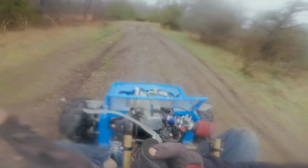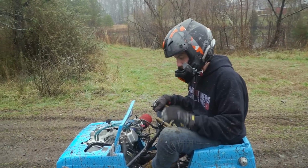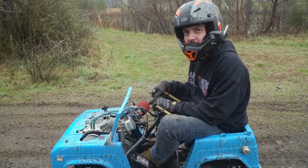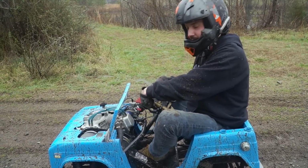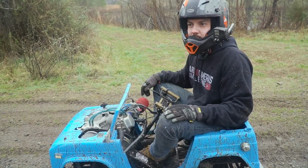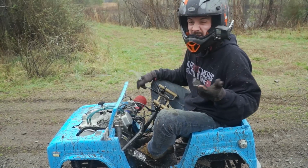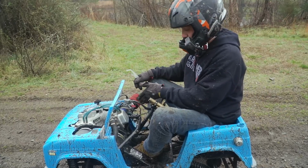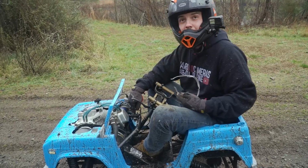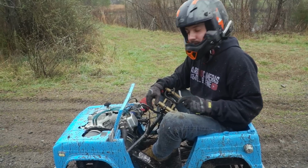Well, hey, it's running better than it was. We're still having a little bit of high RPM stutter, which I think we should probably throw an off-the-shelf Go Power Sports header on it. Even if it comes right in here, just something so we can figure out if it's exhaust or not. Could be coil starting to go bad. Could still be a fuel flow problem. This might not pump enough for the demands of this at high RPM. Could be a lot of things.